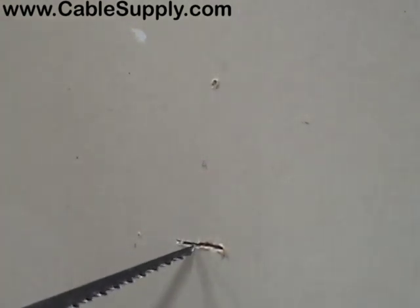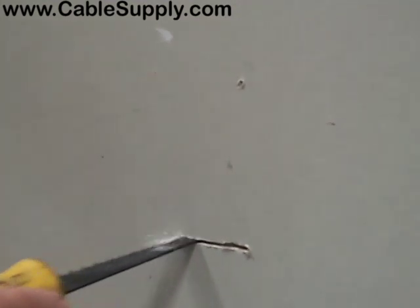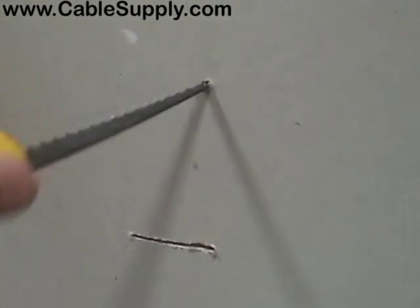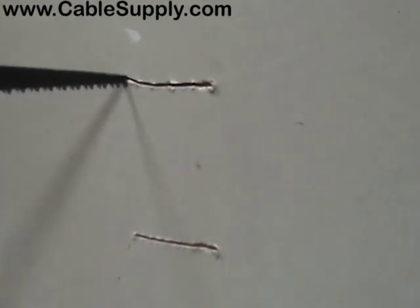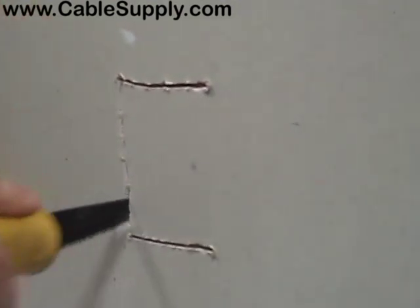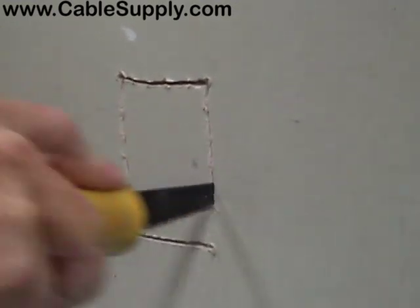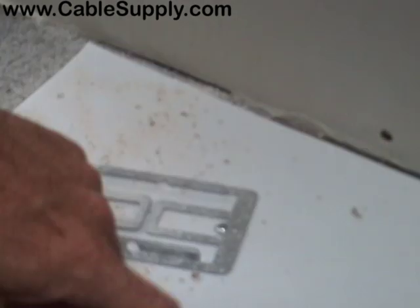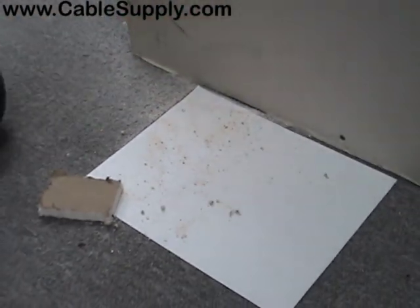The hole I just cut I could reuse and go in the opposite direction. But since there's not a 2x4 in there, I'm just going to continue. No 2x4 — I'm safe. Then I finish the cut. Now notice most of the dirt is caught. This is a little trick we use: just a piece of paper. Keeps it at least cleaner.